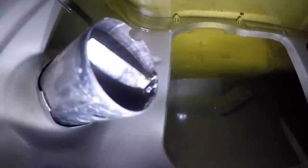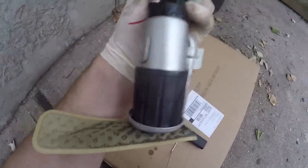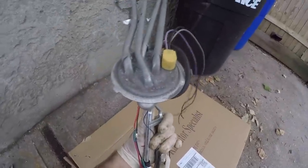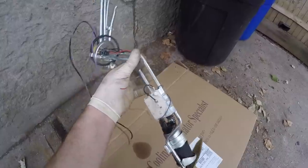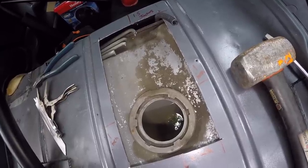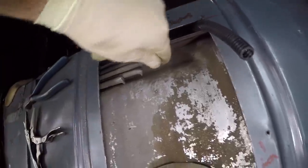Here's the whole pump assembly removed. Here's my current Walbro 255 — this is how I hooked it up when I did the swap. This was a new sender when I put it in — it's a Spectra sender. I'll put a link to that in the description in case your gas gauge doesn't work and you want to replace the sender. Before I close things up today, I'm just going to run into the car and pull the rest of the hard lines out.